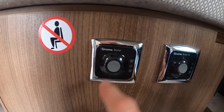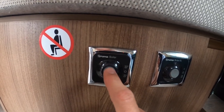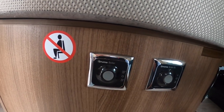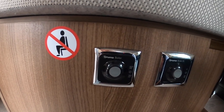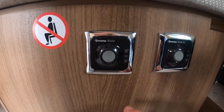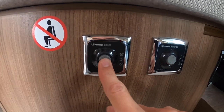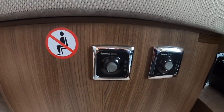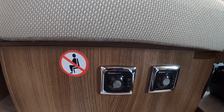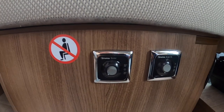You've got heating your water at 50 degrees at the top, or heating your water at 70 degrees. Once the water hits that temperature in the boiler it will stop heating the water until the water cools down and it needs to reheat.